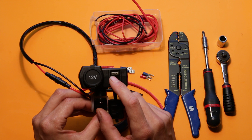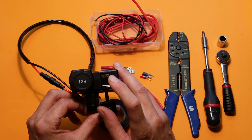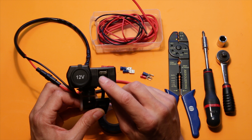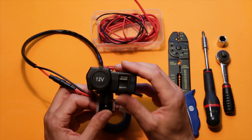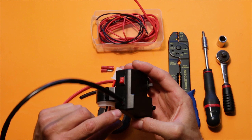I did show you this in a mail day — I'll probably post a link. If the voltage of my battery starts at 12.4 or something like that, and when it drops below 12, I need to stop using this outlet to still be able to start the bike. It looks like it's waterproof, but it certainly isn't.